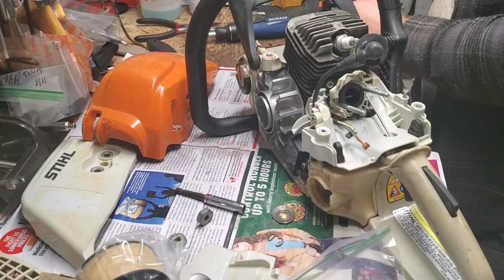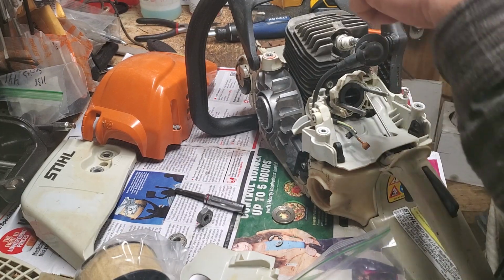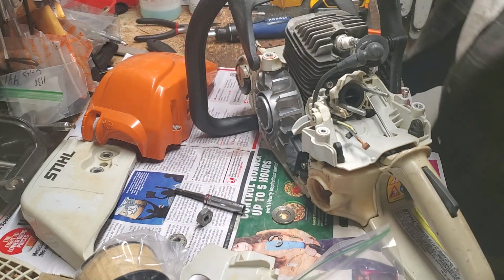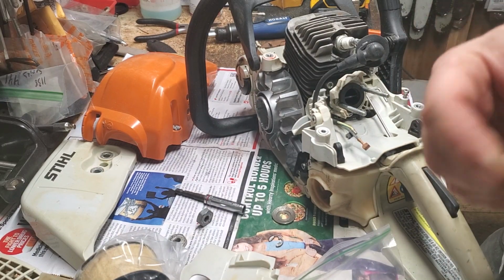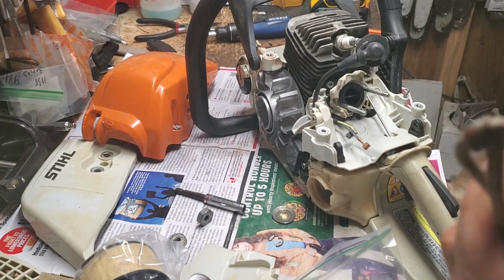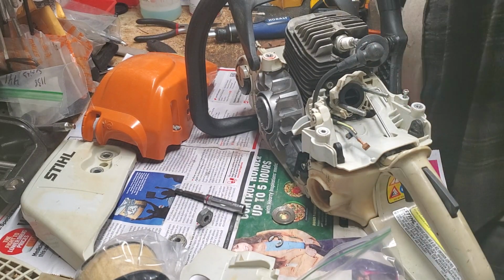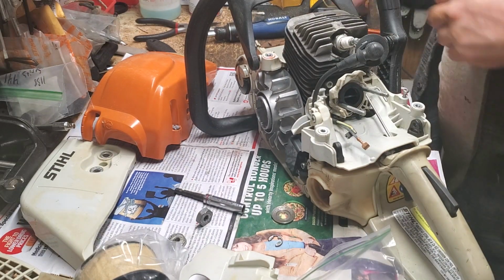Now, again, proper way to do this, technically, get you a 3/4 wrench, put you a rope with a knot. I say a knot, I don't use the end. You can do it like this. I have one here. I like to use one that has a knot in it. It just seems to work for me, okay? Or you can use a piston stop if you really want. And then you hand tighten it.